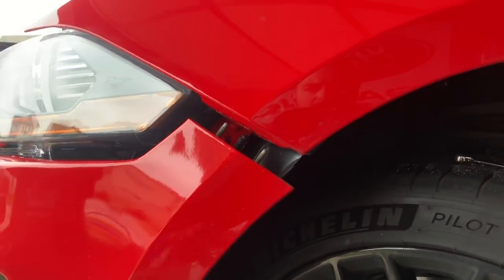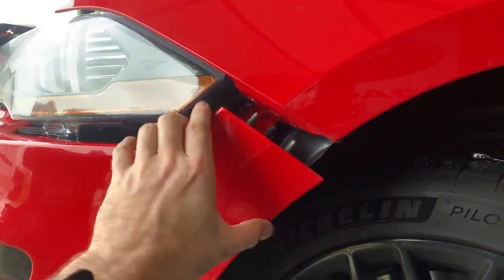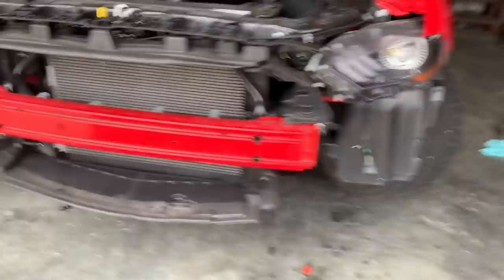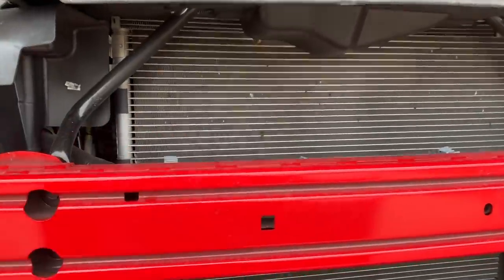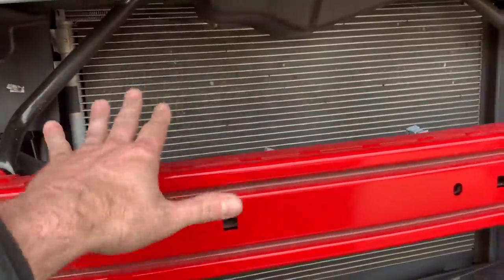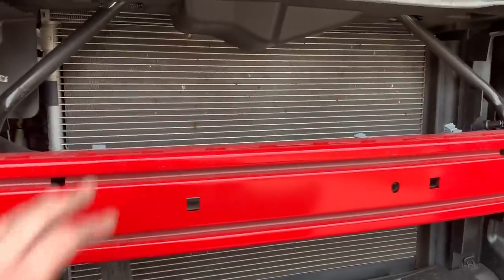Once it is separated, this is how this looks — it's just holding that right up in there, and it looks like this from underneath. You don't have to really take them out from the bumper. This is a change they did for the '18 and '19 versus the '15 through '17 cars; it makes life a lot easier. It just takes small hands to really get up there, but take your time — you'll get it right. It's a lot easier with two people. I will say that once you're at this point and have everything pretty much disconnected, if you plan on painting it satin black or flat black on the radiator, now would be the definite time to do that.